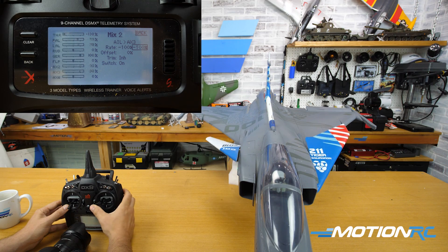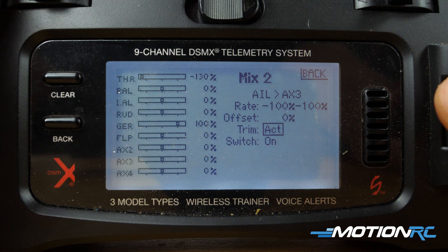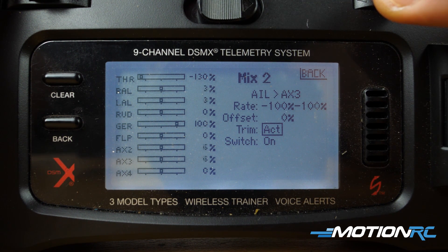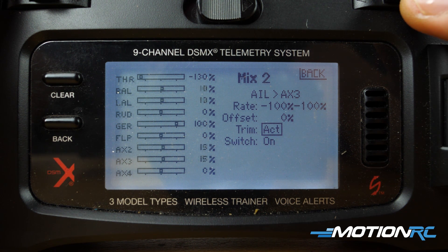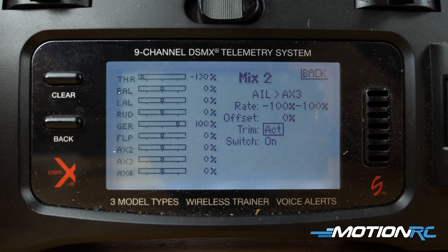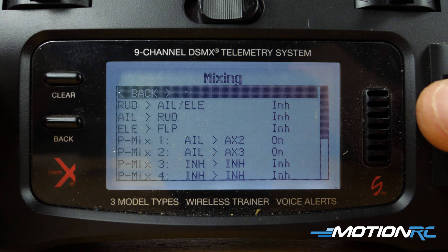Mixes are something you've got to play with. Just because I have it set up this way, the functionality will be the same — this is the page where you'll do it, but your rates might vary depending on certain things. When I come in now, when I move left in the roll, that's what we want to see. My Elevons are perfect in the roll on that side. The left side is moving together as it should, and the right side is moving together. I'm not getting that left canard moving until I also rack the right side of the rate to minus 100%. Now I have properly mixed my roll for the canards. Before you leave this page, activate that trim so you can trim in flight.